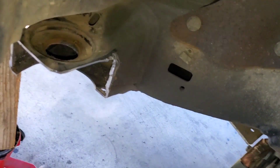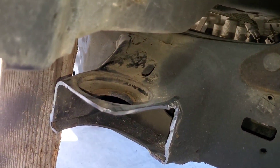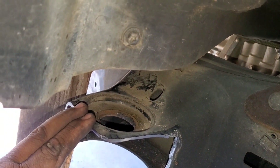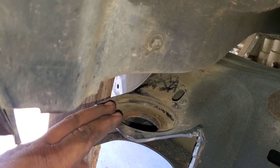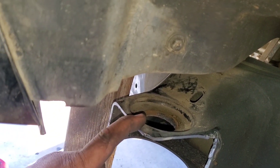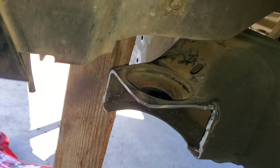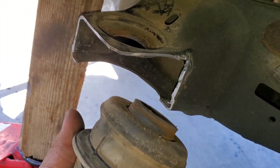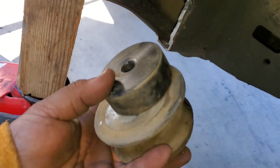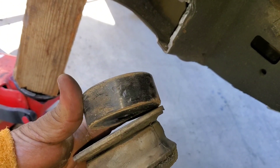Just letting you guys know, I'm the only guy doing this. That's why I'm not showing you how I do it live. As you can see, I've removed the cab mount isolator here. It's important for you to remove this because if you don't, when you weld here, the heat will burn the isolator — which is this thing right here. My buddy Zhang added a spacer.